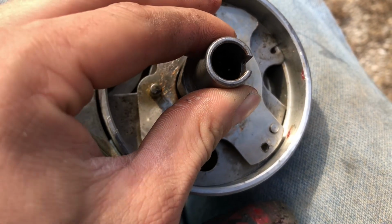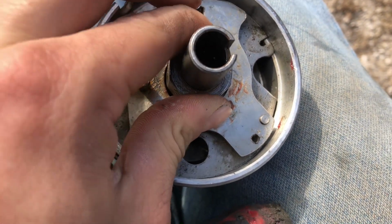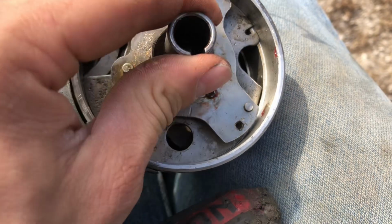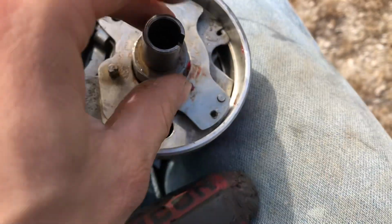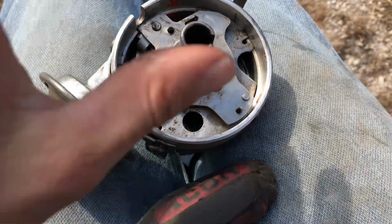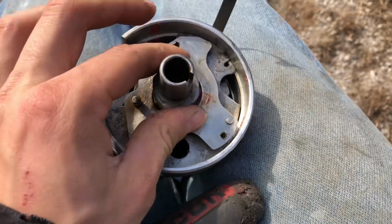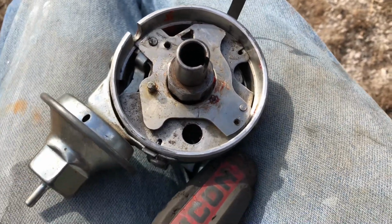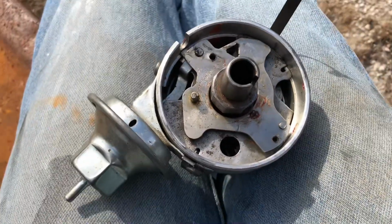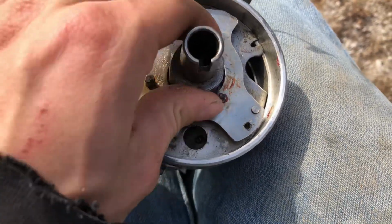That's got a little wiggle. I might be able to shim that up and tighten it up or something. I don't know. I thought about debating, because this was set up for my other cam, and it didn't want as much timing. This one kind of wants a little bit more timing because it's smaller. And technically, it's a little bit smaller than for this engine, because for a 318, a stock truck 318, a 70 stock 318.